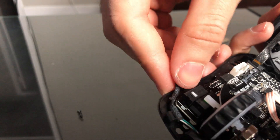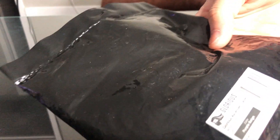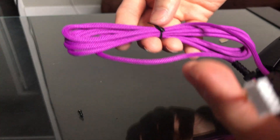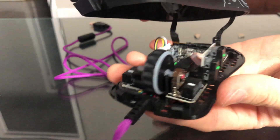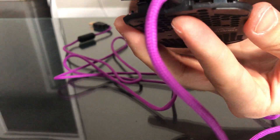You can just take the cover off — slide it up and it will come right out. Then you can take the white plug off without any problems. Just take the whole cable away since you're going to throw it out anyway. This is the cable I got from Glorious — I got the Purple Rain color. That's the white plug that's going to go in — you plug the white plug in and then run it through so the scroll wheel doesn't touch the cable.